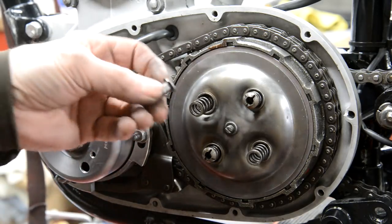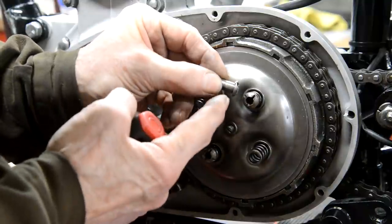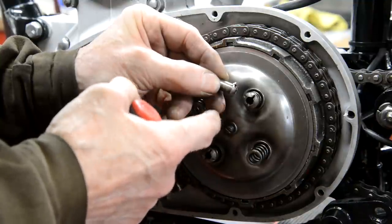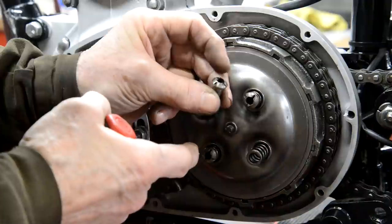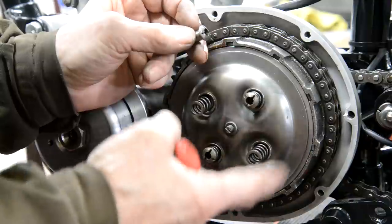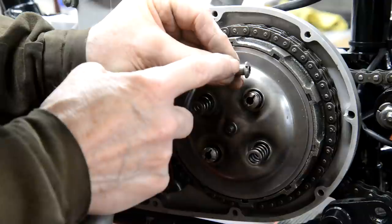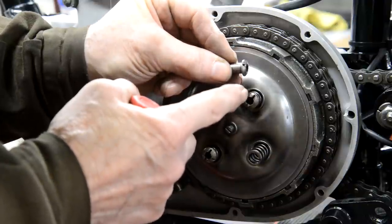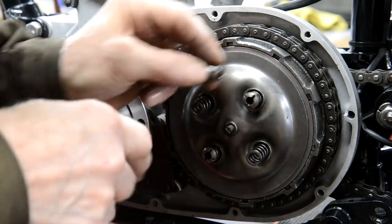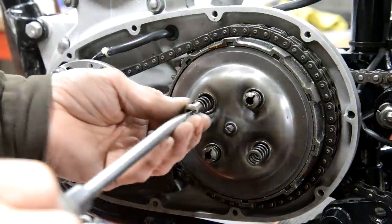You know, what they do have is a little thing bumped down there, and that's to stop it; the actual spring acts like a lock washer. And I remember Charlie mentioning on his website one time about a whole bunch of these that were manufactured where they'd wound them the other way. So that instead of acting as a stop to stop it unwinding, they stopped it winding up. So you screwed it up, you got to a certain point, and then the spring caught in there, and if you don't notice and keep going, it damages the spring, it unwinds it.